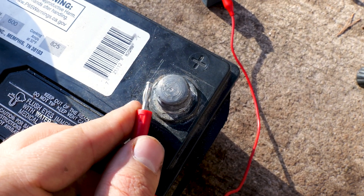And the easiest way to test these is with a relay checker — you just plug it up to a battery, pop it in, and then it'll click it on and off and you'll see if it's working or not. But if you don't have one of those, this is how you check it with a power supply or a battery.